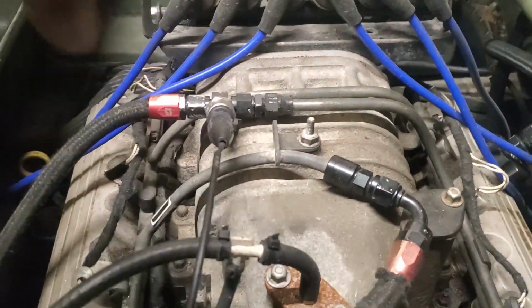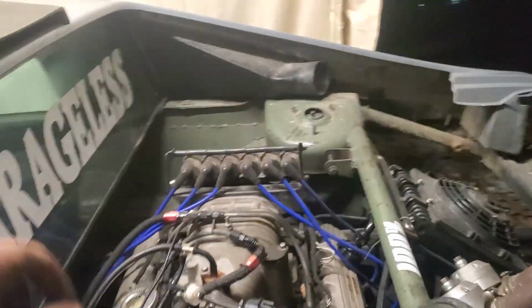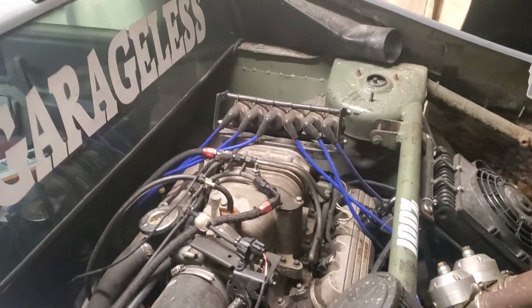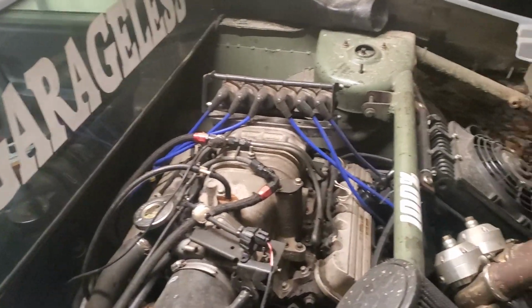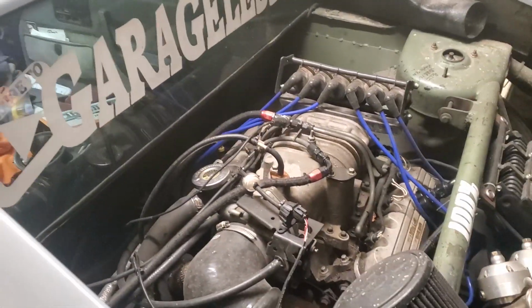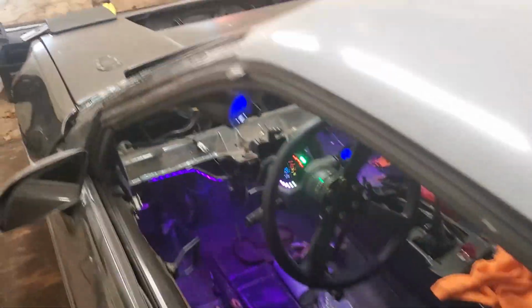Well, if we come in here, I wired in a fuel pressure sensor to my perfect tuning gauge, and that says we're at like 60. So that's pretty high pressure. So I'm gonna probably turn that down, probably down to like 50-ish, if not a little bit more. And then we obviously have to retune, which kind of sucks, but whatever. But yeah, I'm pretty happy.